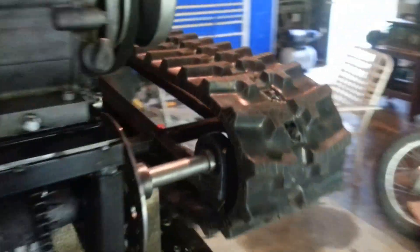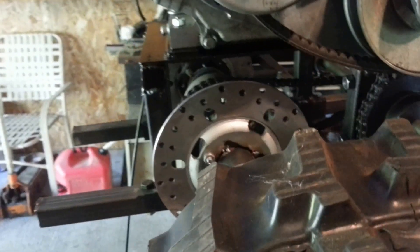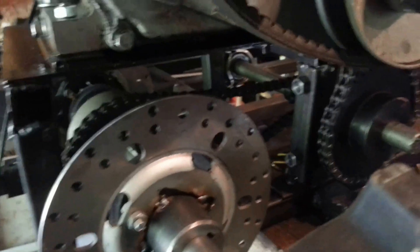That's a little 6.5 horsepower motor and it seems to be running really good. It's got a Comet centrifugal clutch — called for by some of the plans that people are putting out there — and it works well. I don't think it's geared exactly the way I want it; it's going to be kind of slow, but I'm going to fix that.